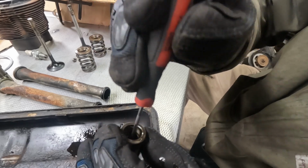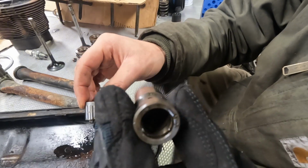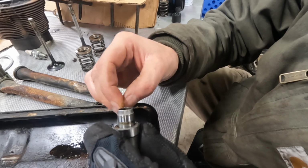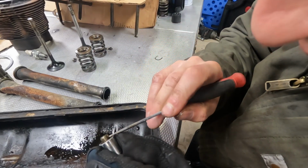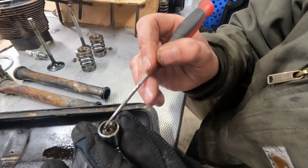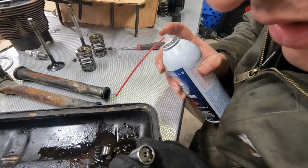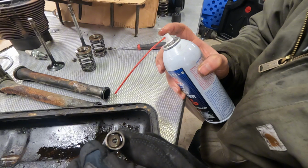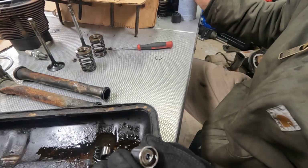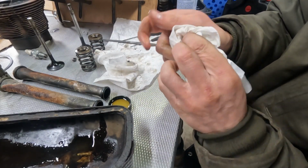Now it's moving. So that's it. The rest is just this case. This sits in there and when properly lubricated moves up and down. And I believe this piece comes off. Yep. And that holds in the ball here, which acts as the valve to let in oil, thus becoming a hydraulic lifter. A cleaning like this will need to be done to all 8 of these, as well as bled. I'm debating whether I just want to order new ones at this point. Okay, I believe that is a fully assembled and not primed lifter.